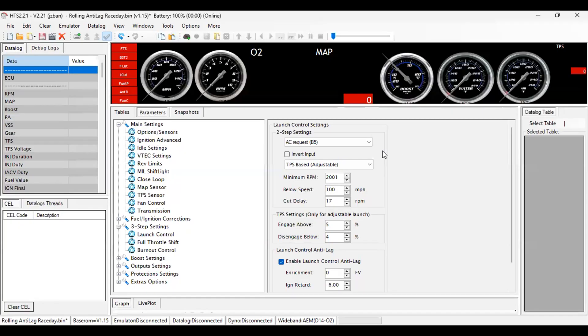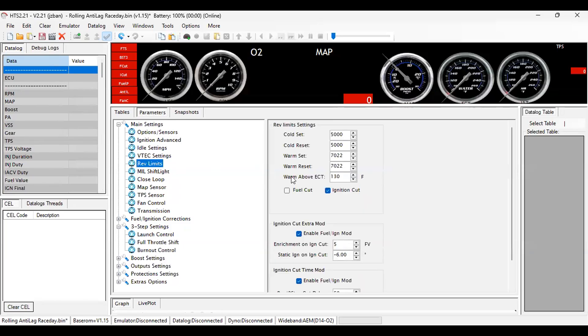The stock clutch is not happy. All right guys, let's head back to the house and I'll show you what settings I'm running. Now that we're on the laptop — head over to Parameters in Honda Tuning Suite, come down here to Rev Limit. Ignition cut only — I left fuel cut off so you're still dumping some fuel, which helps get the spool up a little bit quicker.